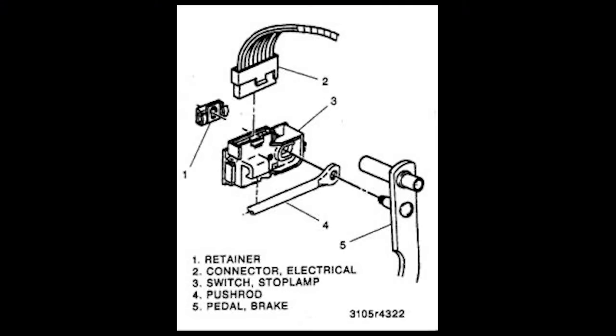I'll insert a screenshot picture here to show the arrangement in case you forgot when you pulled it apart. You'll have your brake pedal with the peg on it - put the rod from the brake booster on the peg first, then set your brake switch back on there. That little loop on the top of your brake switch is supposed to snap onto the push rod that comes out of the back of the booster. Once you've got that all in there, it's super easy to just slide the clip on. You'll see a little groove in the peg on the brake pedal - that's where the clip slides on. Wiggle it to make sure it's on there, because if that thing pops off while you're driving that could be a nightmare.